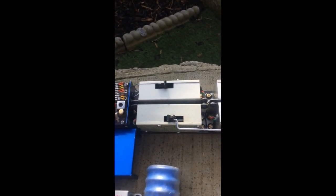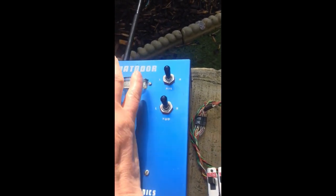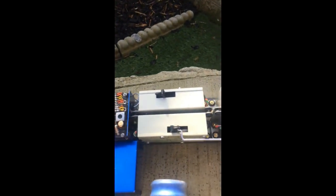If I move over to the servos, you can see the block on the top right is the rudder servo. If I move that, see how slow they are. To the left of that is the motor servo engine. That is known as a progressive servo, where you flip the toggle switch — you just blip it — and it stays in the position you left it, whereas the rudder servo returns to centre, but you're using the same action on the toggle switch to control the control surfaces.